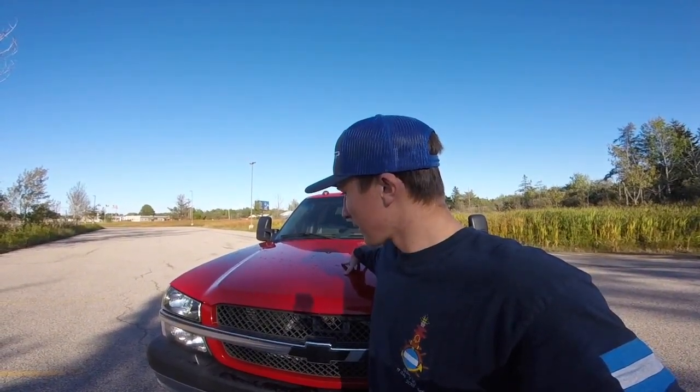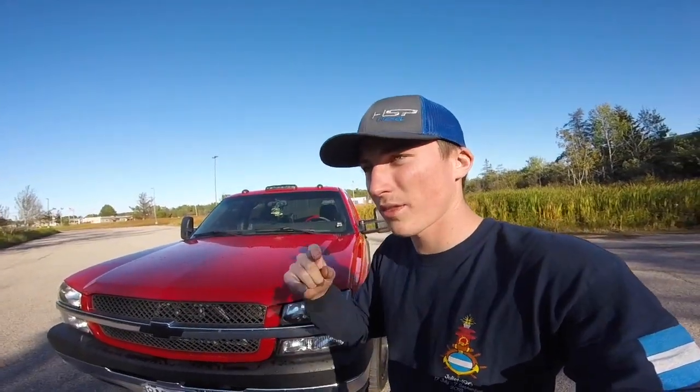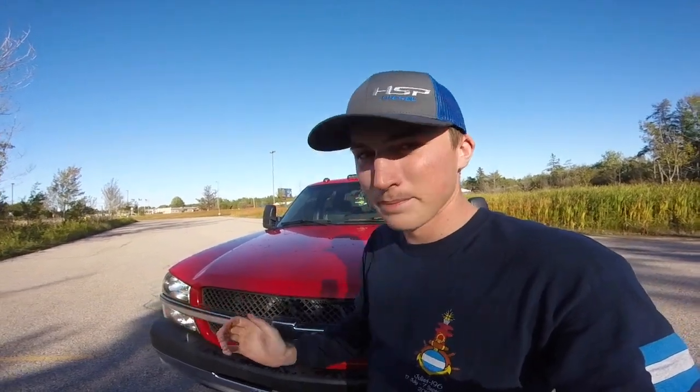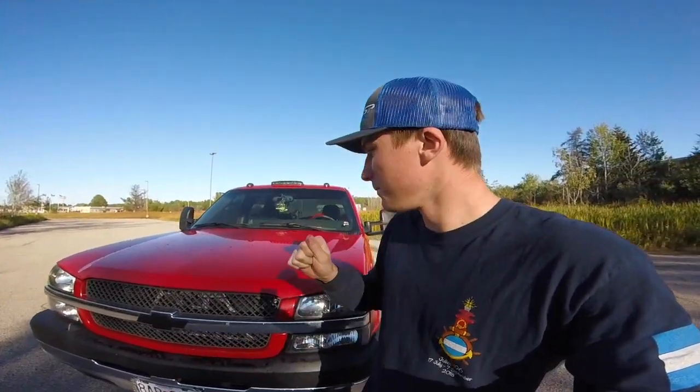But we went ahead and swapped it, put the new horn in. The new horn actually comes with 5/32 Allen bolts. It's nice because the HSP side has the little cutout on the horn to actually slide the horn onto the bolt, so you can run the bottom Allen bolt to the bottom of the turbo housing. So that's really helpful. They really nailed it on that because they made that part a lot easier.